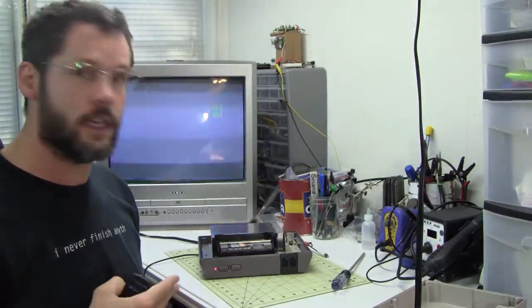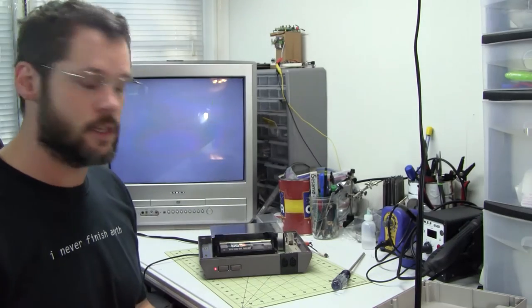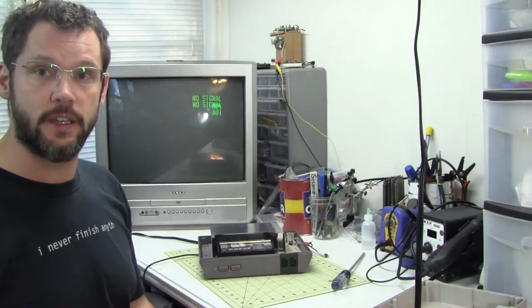Demon has been neutralized. I've got another NES system here with the blinking lights. This one I've cleaned using some contact cleaner, and cleaned the game. I can get it to where it won't even flash, it'll just turn a solid gray screen. I actually got it to play one time, with some corrupted graphics and things like that. The insertion on this one's even weaker than the last NES that I did a video for.